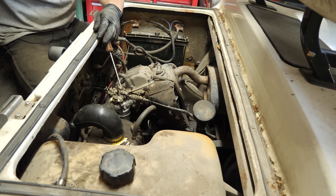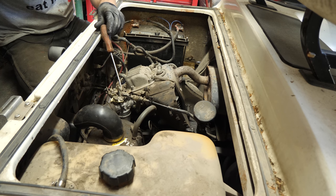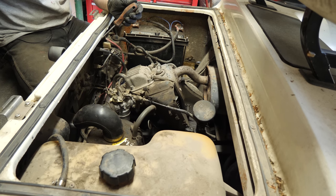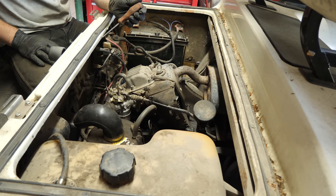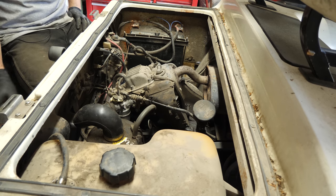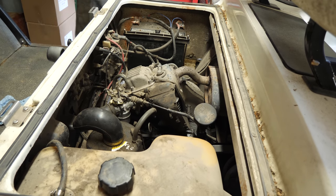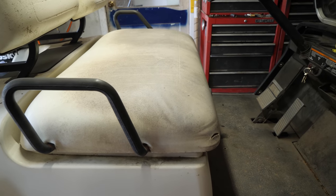Let's do a quick test here. All right, we got it. So that's it for this one — this one's done. Starts and runs, stops. A lot of water in this one, guys — this one had a lot of water in it. That is it for this one; it is running. Some crap in the carb — I thought it was going to be a fuel pump, to be honest, but it kind of was because it was full of water.